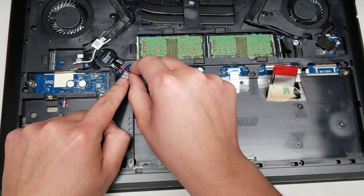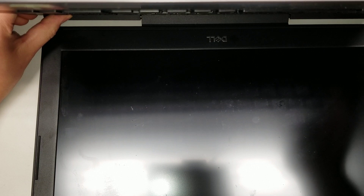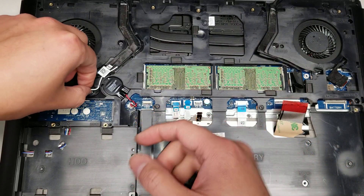You can remove the CMOS battery. If you want to be safe, after you remove the two batteries, you can open it and hold the power button for about 30 seconds — just to be safe. Usually a few seconds is enough, but 30 seconds to be safe.